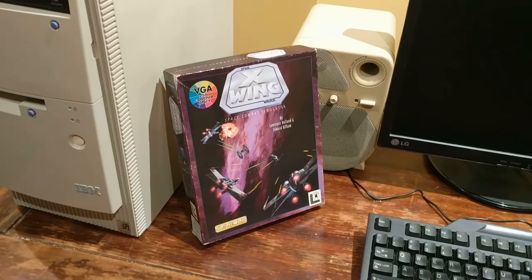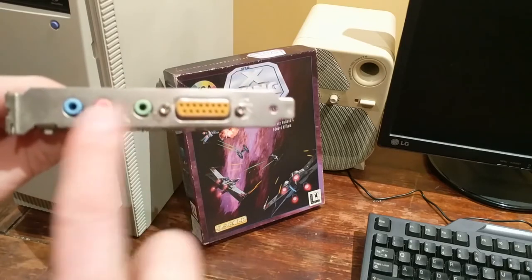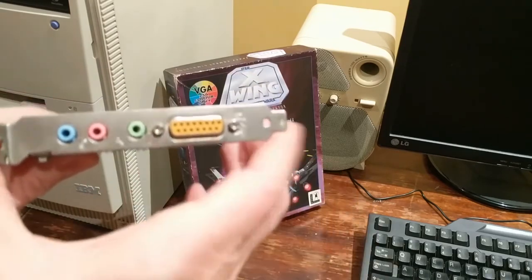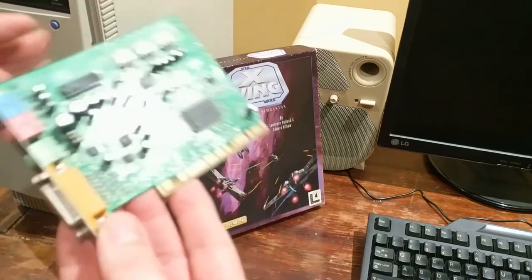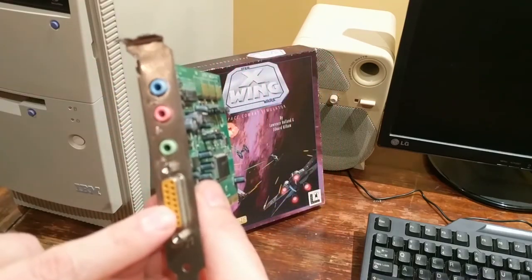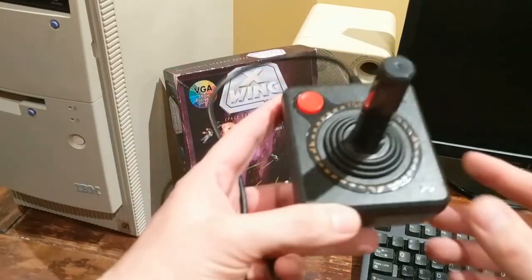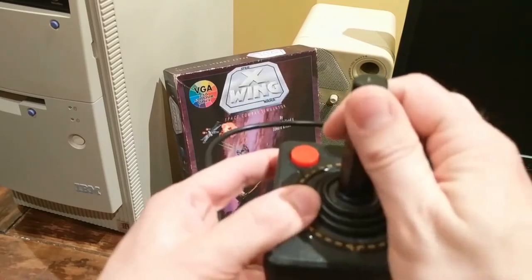This really was the driver — I absolutely needed some way of plugging in a joystick. So what I ended up doing was buying a cheap QuickShot which came with, in the box, a game card as they called it. It was an ISA slot card that went into my 386 and added two joystick ports. It wasn't a sound card, and I later obviously upgraded to a Sound Blaster 16, pulled out that game card, and put in an actual sound card — going from two joystick ports down to only one but having the added function of sound.